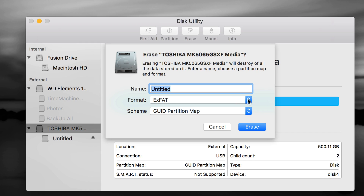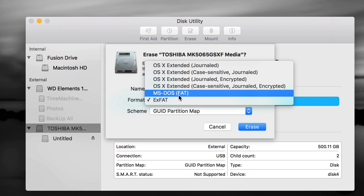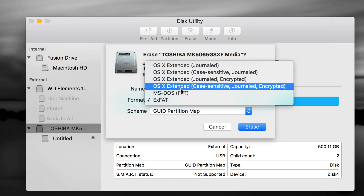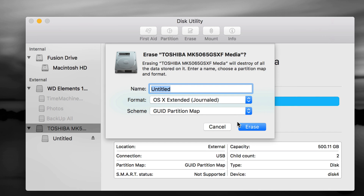I'm going to show you how to make the drive work with both Time Machine and be able to transfer files between Mac and PC by partitioning it into two parts. Also, if you have a Blu-ray player or similar device, you'd need to choose MS-DOS FAT — it's compatible with those devices but it's the worst format. Right now we're going to do partitions, set up Time Machine, and format as Journaled first. Let's press Erase.